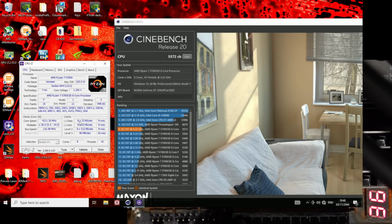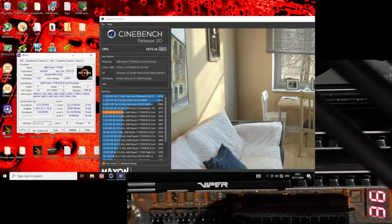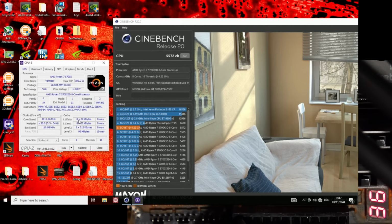The setup that I'm on here is a Gigabyte B550 Vision D-P, which is a motherboard that was generously donated by a viewer several years ago. The memory sticks that I'm using are Patriot Viper Steel DDR4 4400 CL19 single rank Samsung 8 gigabit B-Die. The XMP is not enabled, of course, because 4400 does not work. Well, on this board it does work, but you wouldn't want to use it anyway.